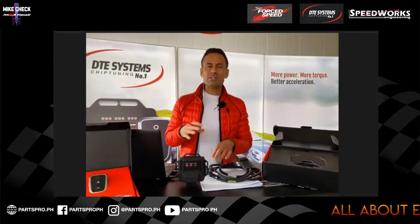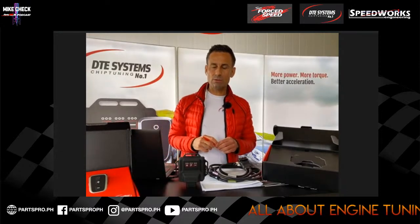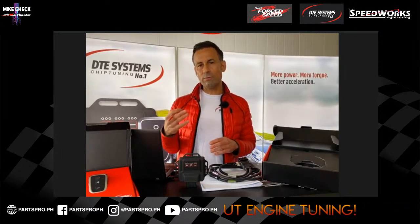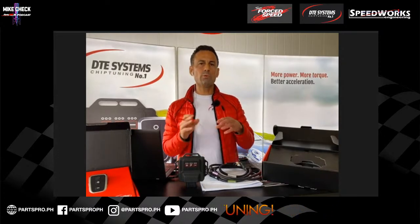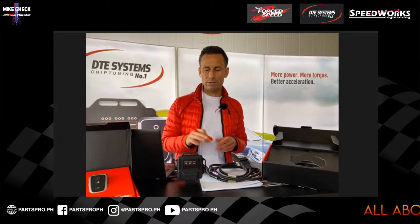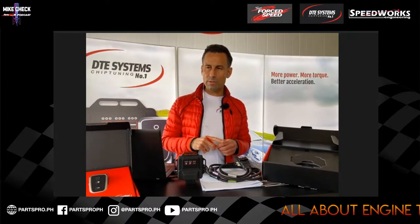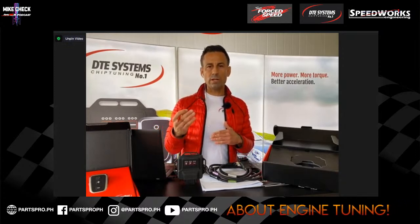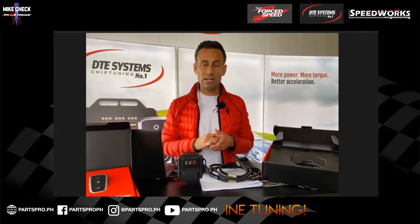It's not the general case, of course, but worldwide we have some petrol heads who want a more aggressive file, and here we can custom tune, and we send this file via remote to the smartphone of the customer, and the smartphone connects via Bluetooth with the power control and installs the modified file directly to give more power to the engine. But we always have to keep in mind that we have to stay inside the tolerance of the engine. It makes no sense to give even more power if a check engine light comes up, or in the worst case, the engine turns to limp mode.